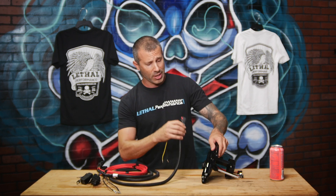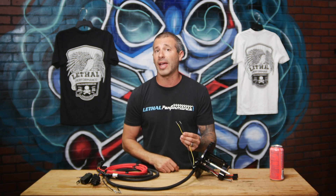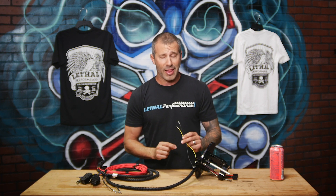When you've installed our wiring harness and you plug the six-pin connector into our fuel hat, you've got two other wires hanging. These wires are going to go to the two small wires on that factory wiring that you cut at the fuel hat, and this will be for your level sender. Your yellow will go to yellow and your black will go to black. That is it.